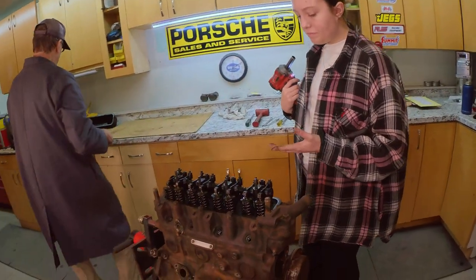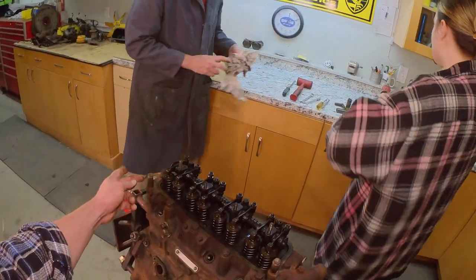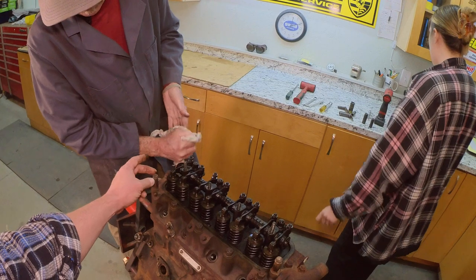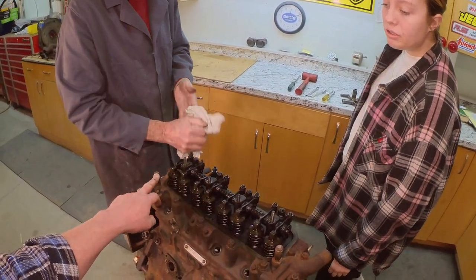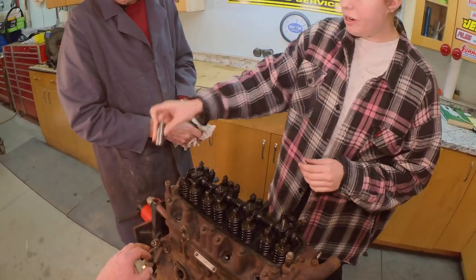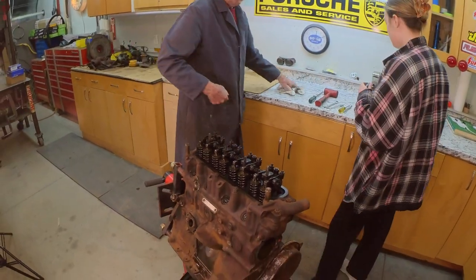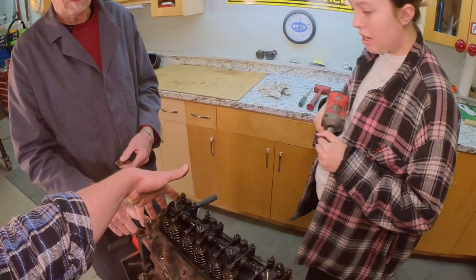Now you can get a... I don't know what this guy is here. He's a head bolt, right? I'm guessing yes. So you'll need a half inch to take that out. Well, you might have to zip him out and then start on your 9/16s. And then do you think we should take this off in a pattern? I would start on the outsides.